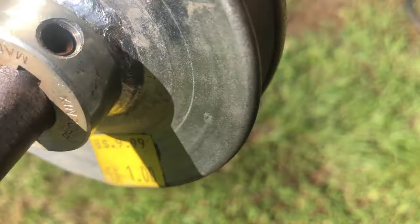So we just survived our first test drive. Belt only came off, I think it was three times. And the shifter is a little bit iffy. That's in first, that's reverse. First, when you go over, that should be second, that should be third. But sometimes when you're putting it in first, it's going into third. Something you gotta watch. Anyway, I wanna get the throttle hooked up so we can idle it down, and I wanna kill switch. That's my next two things, even before running board.